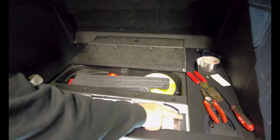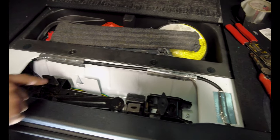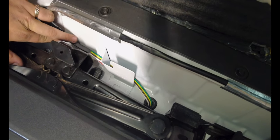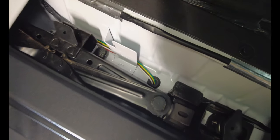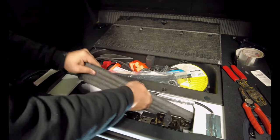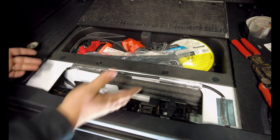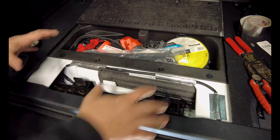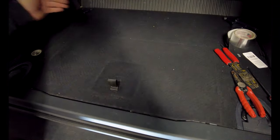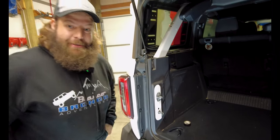We're going to fish the trailer wire up from the bottom, route our wires out of the way inside, tape them up nice, then jump below and connect everything. I think we're going to get famous for using duct tape, but it works so well and it's so sticky it's not going anywhere. We ran our wire around the perimeter of the jack box and poked it straight down in there. All of our junction is made right in there adapting to the new trailer wiring, and all the jack components go right back where they belong.